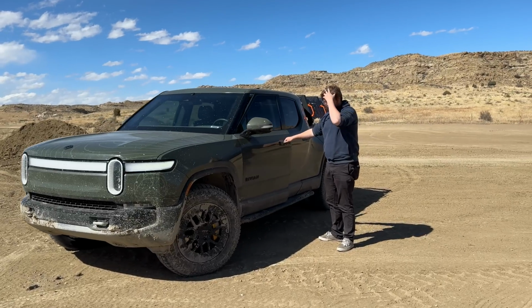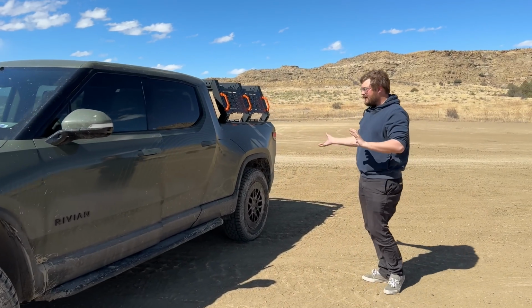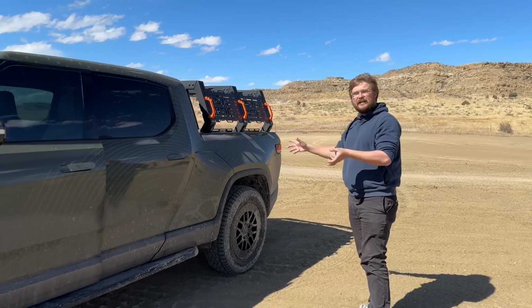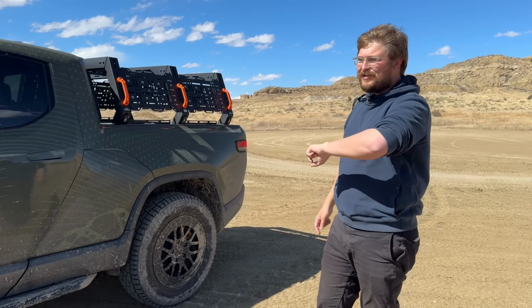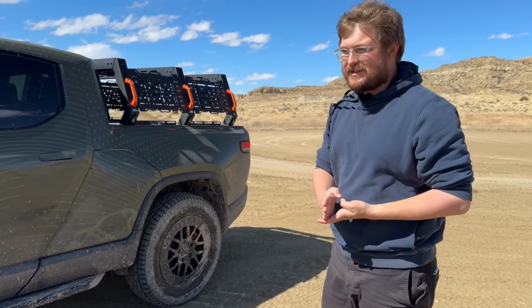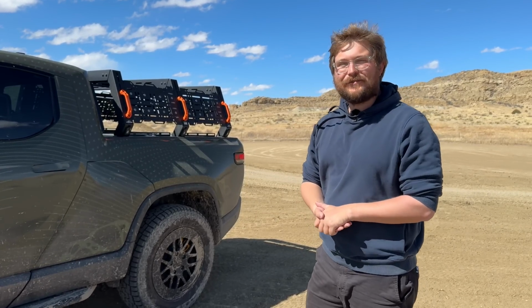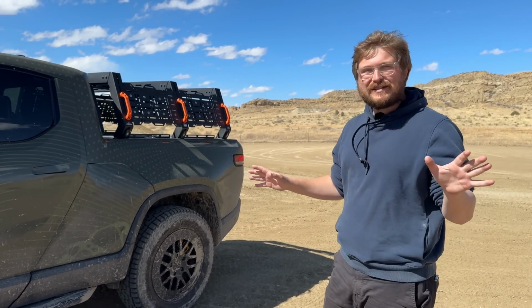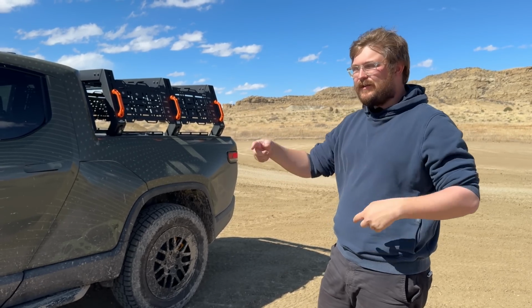So this is a very similar system on the rear axle of the Cybertruck, where each motor on the rear of this vehicle is independently controlled. There's no differential between them. And it's actually the same on the rear and the front. This is a quad motor system, a 4-motor system. Now the dual motor Rivians actually are very similar to the Silverado EV. No physical lockers, relies on the ESP system and their tuning to transfer power cross car.